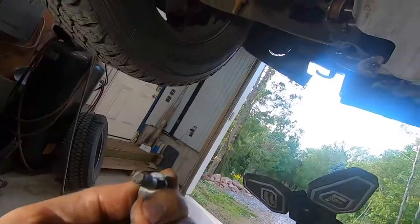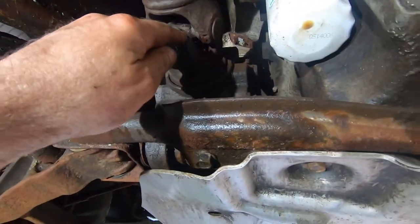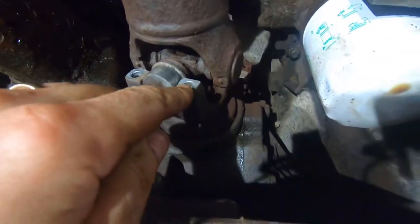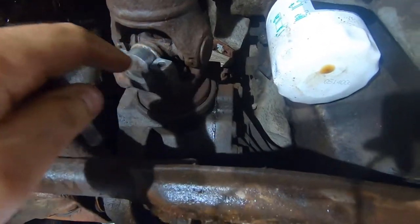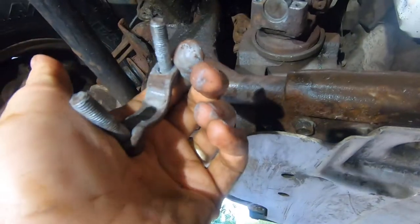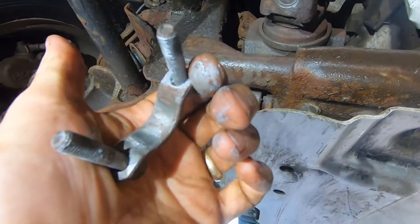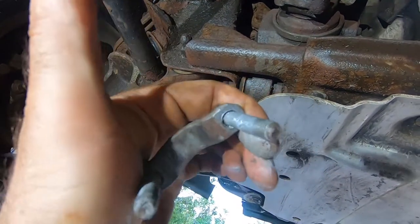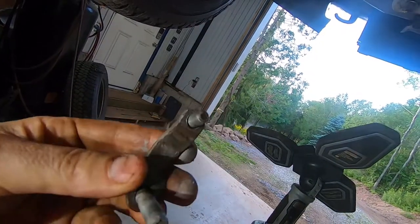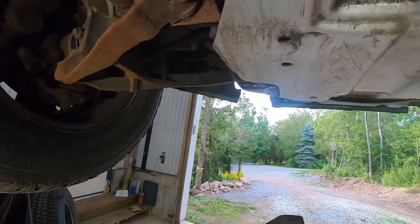The bolts were tight — no problem there. When I took the strap off I could see clean steel all the way around, which means there was no corrosion. I need the strap for it to lift away. It looks like it just wore somehow — there must have been a vibration and it wore. So I'm going to take this strap, clean it up, straighten it out a little bit in the vise, and put it back on so it grips tighter and see if that helps.